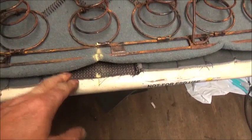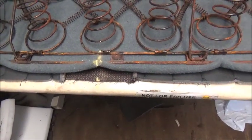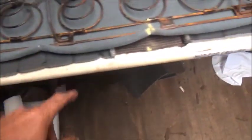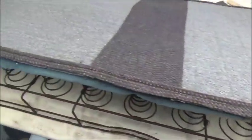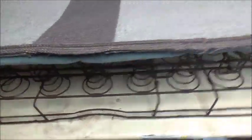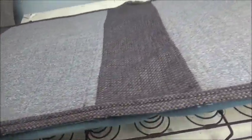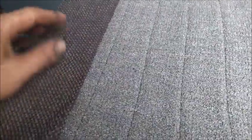Now we've got our cover upside down below it, marked center. We're going to do the same thing on the back, try to get this centered as good as we can, then go around it and mark where we want to cut it out, and then put our piping on. We've actually got the piping sewn in all the way around and we're getting ready to get some foam on this thing so we can get our measurements for the front and the sides — they taper really big. I may go with some two-inch foam; I did an inch and a half on the backrest and it done pretty good. I still need to add my half-inch foam underneath.